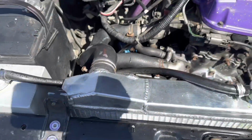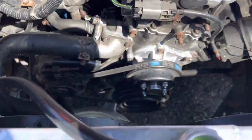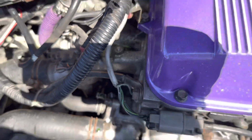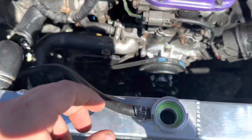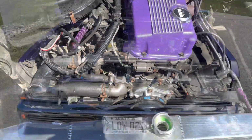All right, we've gotten our coolant drained, and now I pulled the bleeder screw, and we're just going to fill this up until it starts steadily dripping out of there. We got a nice stream. I'll put it back on, and then we'll turn on the truck. I'm sure once the thermostat opens, we're gonna have to pour some more in. So I'll see you guys once I do that.